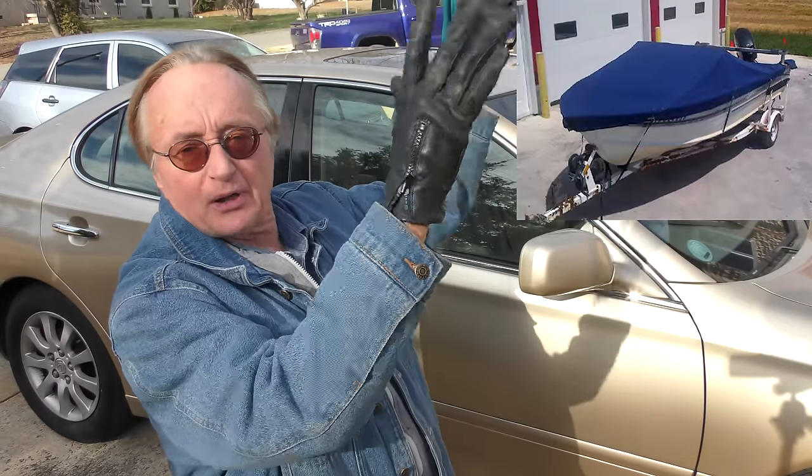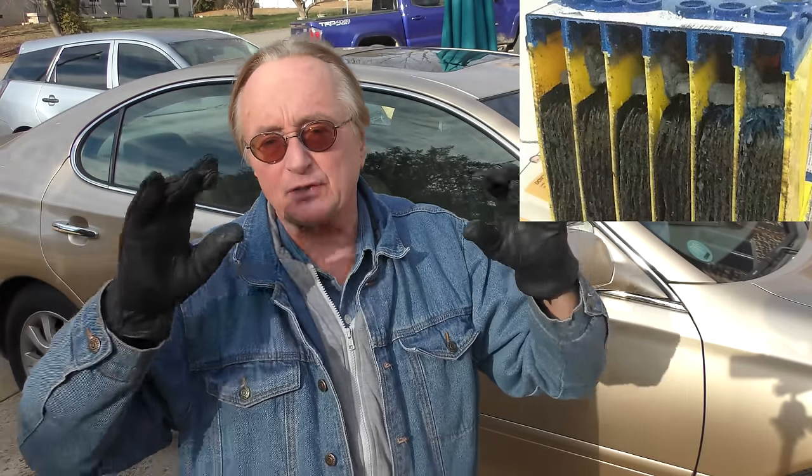Let's say you're going to park weeks at an airport — just leave it charging. Maybe you've got a car out in the country, leave it there. In the case of my son, we got one hooked up to his boat out in the country on the trailer. Last year it went flat dead and it wouldn't start the boat — what a pain when you get to the water. Since it's waterproof, we just put it on the outside of the tarp on the boat, plug it into the power outlet, and voila — it keeps the battery charged and makes it last longer too. One of the worst things for batteries is to let them go completely flat — it'll kill their lifespan. This is actively float charging it, then it leaves it alone, and adds some more when it needs to.